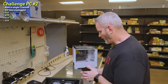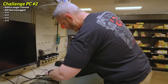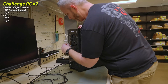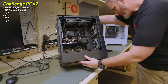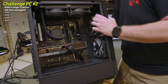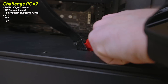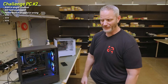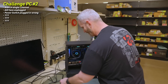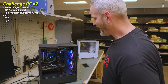Visually that's all I can see, so I'm not even going to open the back yet. Typically I like to just see if it'll POST — which it more than likely won't because this is the whole point of this challenge. And yep, the power switch is plugged into the power LED. See — power SW is plugged all the way to the left, which would be power LED. After fixing that, it actually does get an image. This is a higher-end Intel platform — you can tell by the motherboard. I just want to see if we at least get an image. We do.